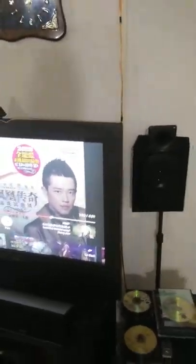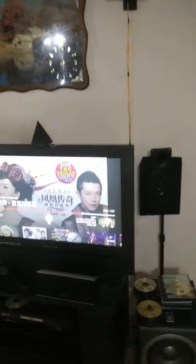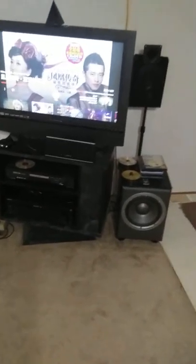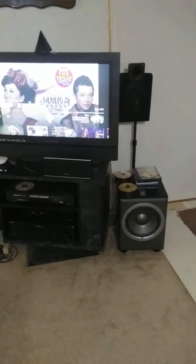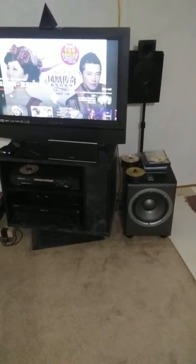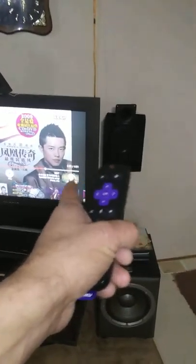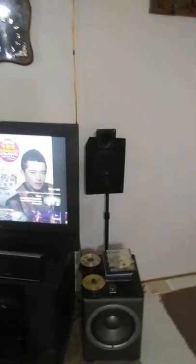That's with no sub, with those 6x9s — basically I'm set up to only move and wiggle down to 60 Hz. This sub will go down to 20 Hz. I have it set right now to about 35 Hz. I'm gonna turn on the sub and let you hear the difference. You can set these speakers up — if you box them right — to do close to the same as this sub, so you don't need a sub unless you're really cranking.